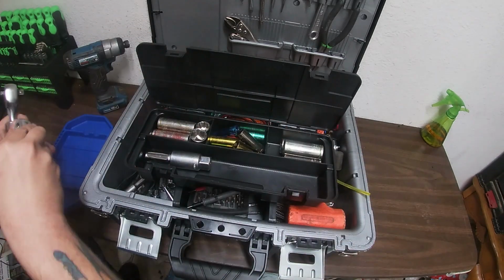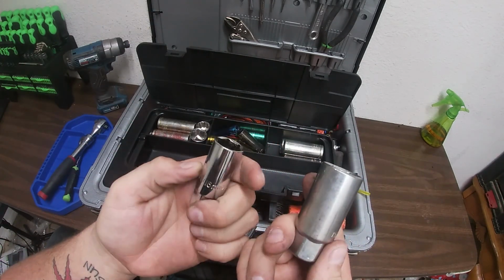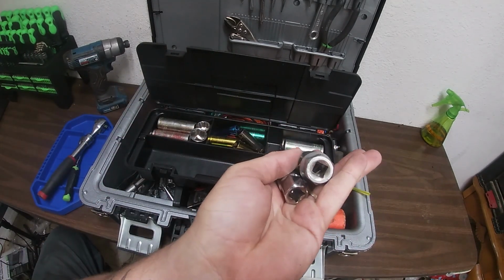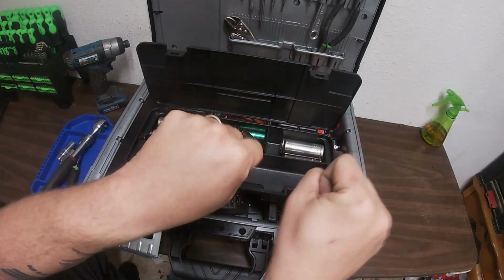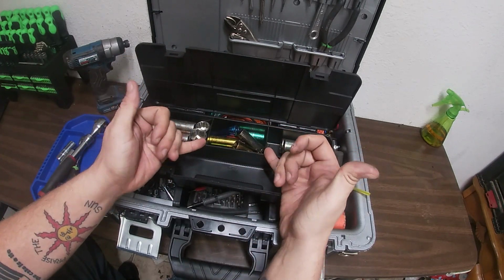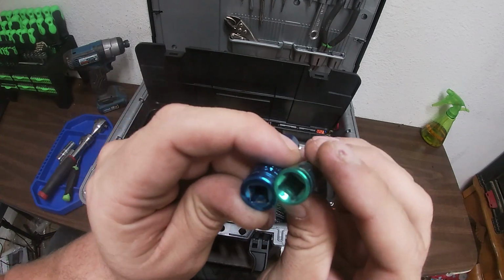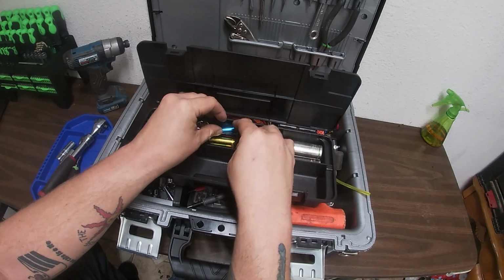Now with those two out of the way, you want to carry one of each of the spark plug ones. You want a 5/8 and you want a 13/16 for spark plugs. Very important. Both of these are 3/8. That's one of the reasons I carry the 3/8. And for if I got to take off heads or something, I got a few fitter. So right in here, this is 9 to 14. These are 1/4 inch drive sockets. Sorry, I mean, these are size 7mm to 14mm for the 1/4 inch sockets.